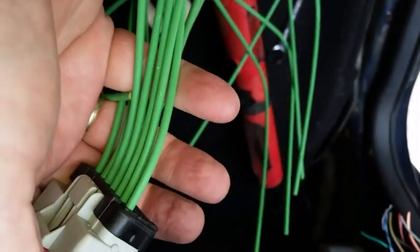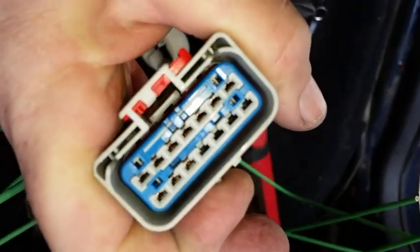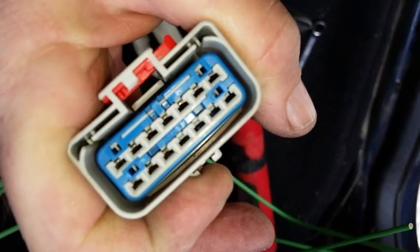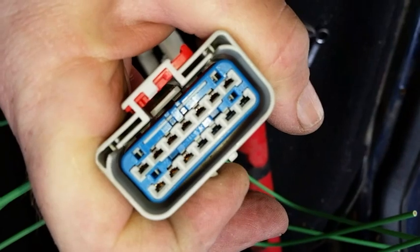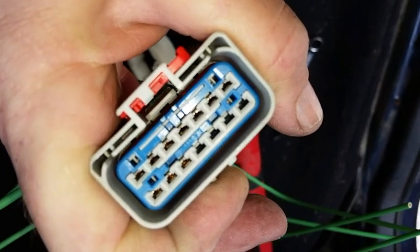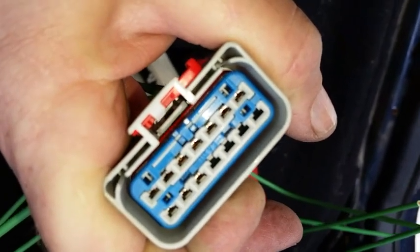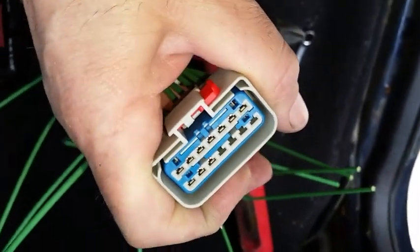If you made a mistake, you could take these connectors apart pretty easily. You put a screwdriver through there on the back, push that blue portion forward so that it's back to where I showed originally, and then you can put a very small screwdriver into the little rectangular notch in each of those rectangular pin positions. Use a very, very small jeweler's screwdriver so you don't hurt the connector, and then just disengage the plastic clip that's on the gray part of this connector. That hole that I mentioned earlier has to be facing a certain way, and it will let you pull the little plastic tab out of that hole, and then let you pull the wire out, and you can replace it if you had to. But that's another video, on how to do pin replacements on connectors.